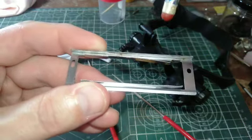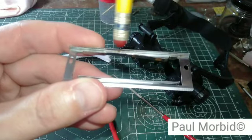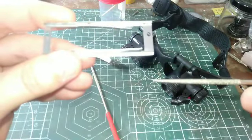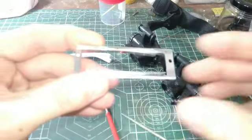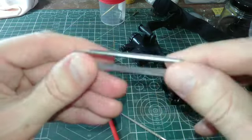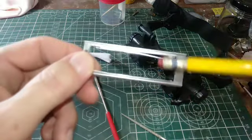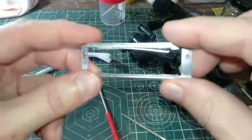Using my jeweler's magnifying glasses, I found more rust on some smaller particles. Some of it's fairly deep and I've got to continue scraping around with a diamond file here to see how deep in it is. In doing so, I'll find out if I need to re-chrome this piece — and if I need to re-chrome it, I'll have to clean off the chrome and powder coat it.